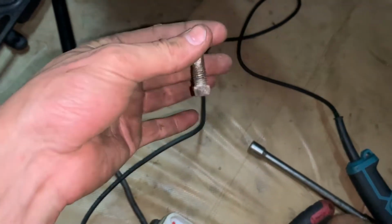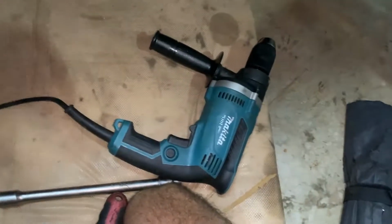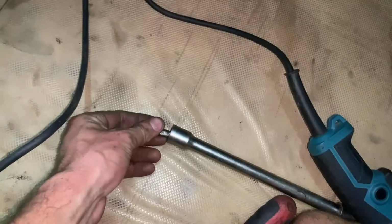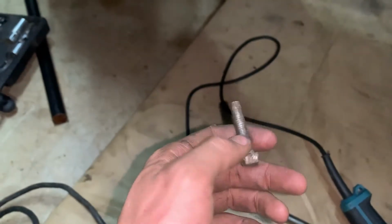This is something I just have to show you guys. I made my own homemade impact wrench type thing with a normal drill. I just took an old bolt and made a 1/2 inch drive over here that fits into the back of your socket, and this goes into the chuck of the drill. I'll show you guys a better video of me using it just now. Going to get those bolts off under the oil sump, and yeah, I just thought I'd show you.